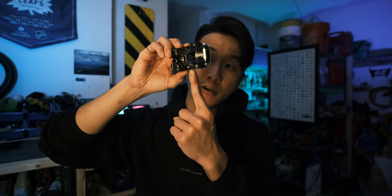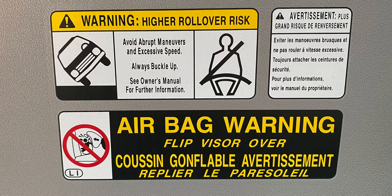Another important point about putting things on your roof rack is that it raises your center of mass — the point in your vehicle where, if you try to balance it on your finger, it stays steady. You always want a low center of mass for stability and safety. As you add more and more weight to the roof, the center of mass gets higher, making the FJ more susceptible to rolling. Even at stock, Toyota warns that the FJ's center of mass is higher than a typical vehicle. The moral of the story: the less mass you put up onto your roof, the better.